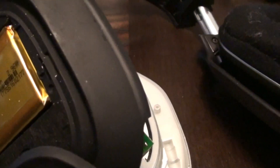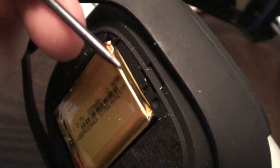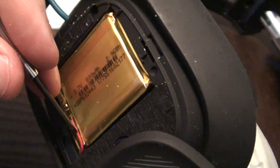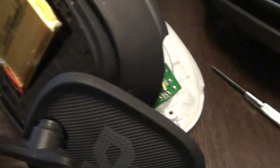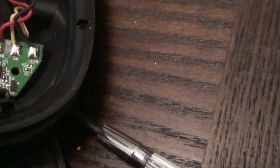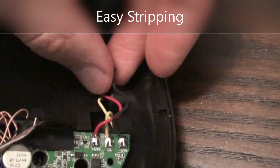Flipping it over will expose the battery. It is lightly glued in there, so use a tiny flat head and work your way around, being careful not to disturb the wires because you are going to need those to put the new one in. With the wire cutters, cut as close to the battery as possible to give the most wire length to work with. Pull all three wires through for easy stripping and then we will find a place for them.